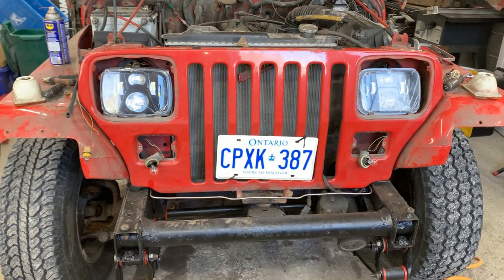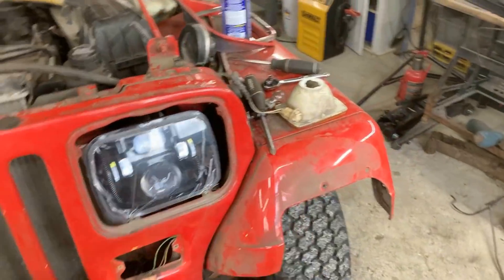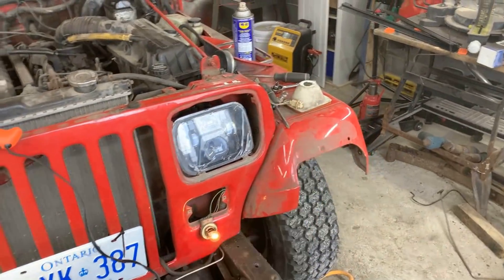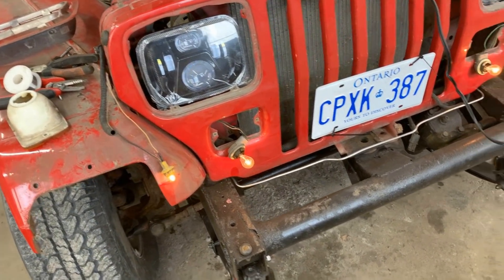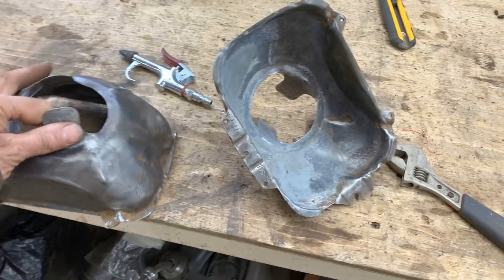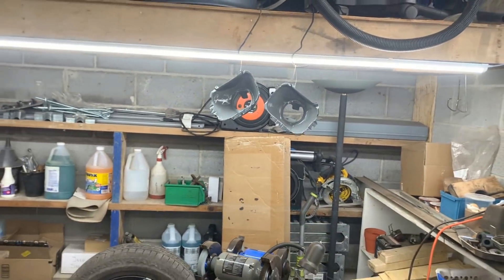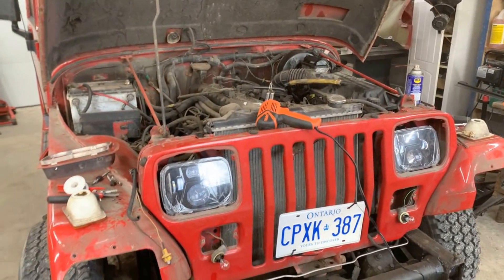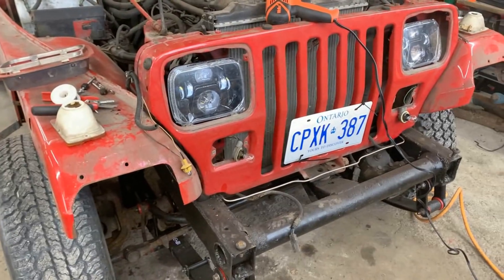Let me solder this and clean up the buckets so I can paint them and let them dry. The bulb was not good in that one, but I took a bulb from another spot and now it works — I just need another replacement bulb later. The wire was soldered and I put some shrink tubing on it. The front end is fine — I'm just going to paint those buckets. I cleaned them as best I could; I'm going to prime them and throw some black paint on them later. Now that we know everything electrically works fine here, let's turn our attention to the tail lights.